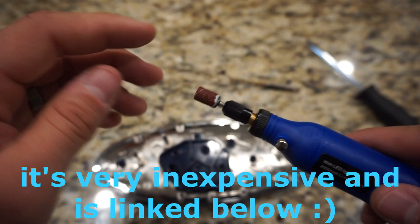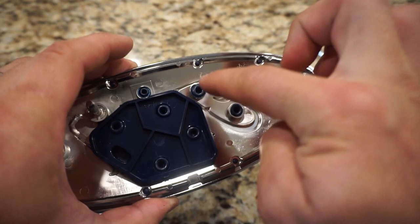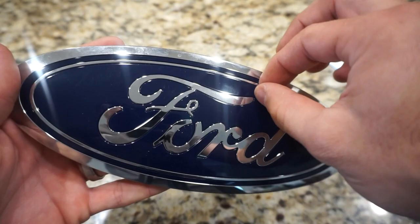A lot of people don't have this tool, but I happen to have a small Dremel rotary style tool, and I'm just going to be using a little grinding wheel or a small drill bit, going along and lightly drilling or grinding down the outsides of these. Once you've broken all those welds off, this piece will pull back, you'll be able to flip it over, and these guys will just fall and pull right out.